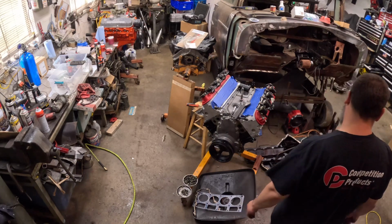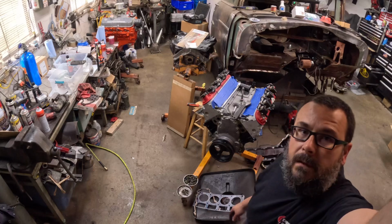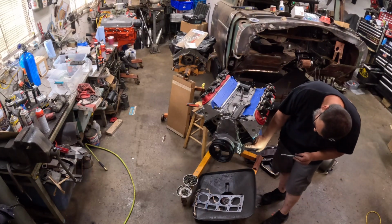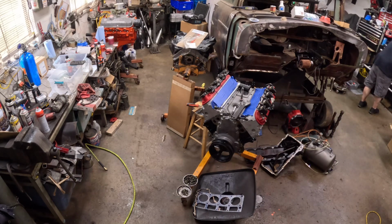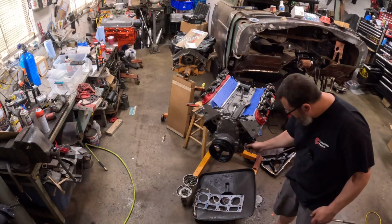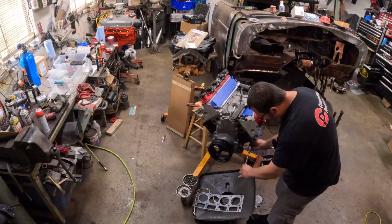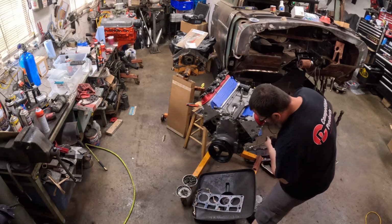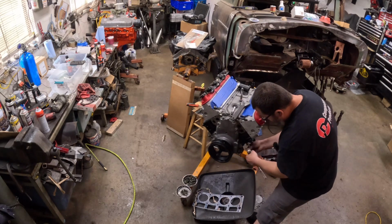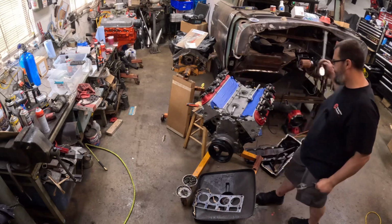All right, now my oil tank, we need to pull this plug out right here inside the block. So right here in the block, you'll need to pull that plug. Sometimes they can be pretty snug. It's an 8mm hex. 5/16 would probably work if you had to, but so let's pull that guy out. Set it right there. I'll put this junk up.